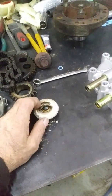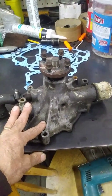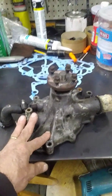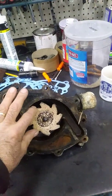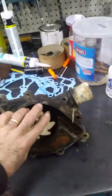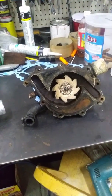I did a test on the thermostat and it did open, so that caused me to check deeper. That same night I finally got the water pump off. It was about eight or nine at night - I was groggy - but I thought maybe the impeller on the backside came loose right here, because sometimes they spin free on that shaft and just come loose. I checked it and it wasn't loose, wasn't free-spinning, so I still wasn't understanding what my problem was.